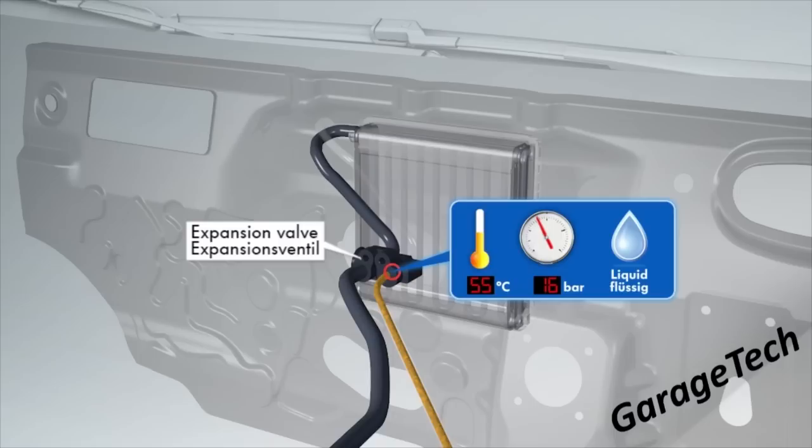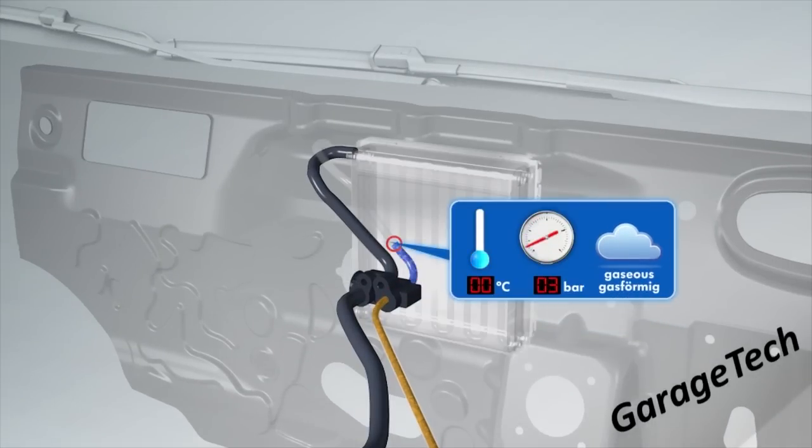On the low pressure side you should be running between 1.6 to 2.2 bar, which is 25 to 30 psi. Inside the thermal expansion valve there's a very small hole, adjusted by a wax thermostat, which changes the pressure from the high pressure side to the low pressure side. As the liquid escapes through the small hole it immediately turns into a gas because the liquid is able to boil immediately. This boiling drops the temperature — turning it into a gas vapour — and this is where your cold air comes from.